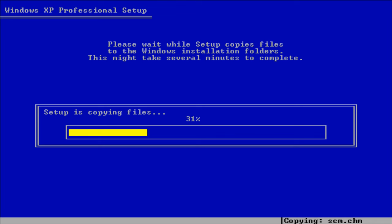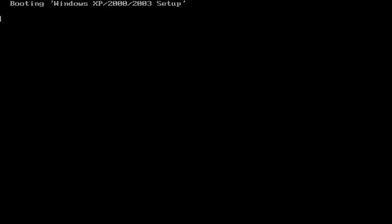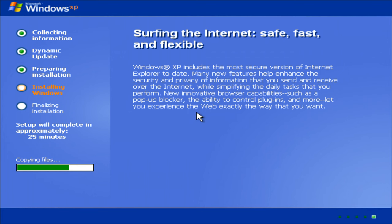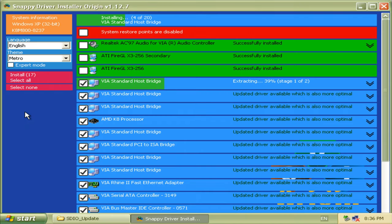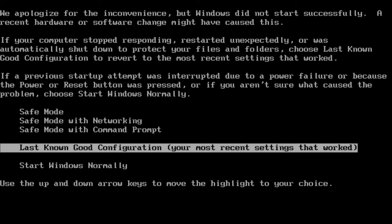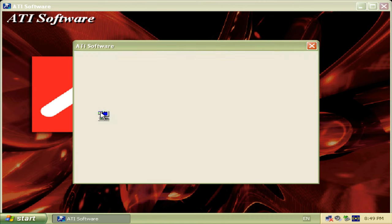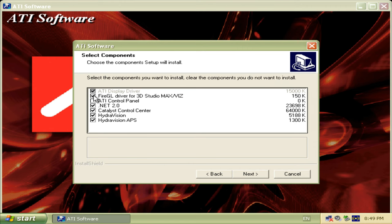We will test Windows 98 and DOS a little bit later. Let's begin with installing Windows XP. I tried using the WinSetupFromUSB project, however we're getting USB 1 speeds — way too slow. So I ended up connecting an optical disk drive and installing from the good old CD. For drivers we're using the Snappy Driver Installer Origin project. Usually I deselect graphics and audio, but for this project I selected installing all the drivers — and of course it fails to boot. The fix is easy: choose last known good configuration, then manually install the latest FireGL drivers from the AMD website.